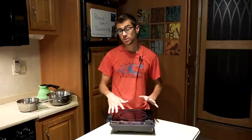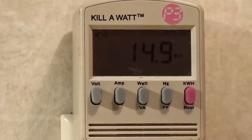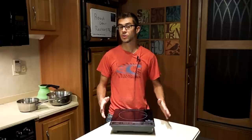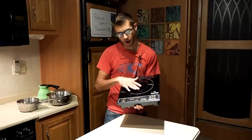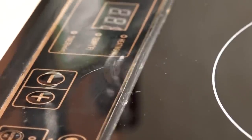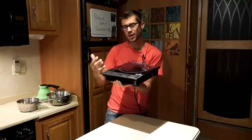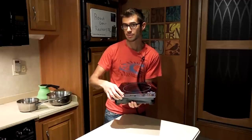In testing its power usage I noticed this unit draws about 10 to 15 watts at idle when just plugged in, which is a drawback — you don't want to leave it plugged in all the time, especially on an off-grid solar system where you need to conserve energy. Also, in three years of ownership, one pan got really hot and touched the plastic base, and there's a tiny bit of deformation where it touched. Having the cook surface flush with the plastic sides is a bit of a drawback because you don't want a searing-hot pan to accidentally touch those plastic parts.